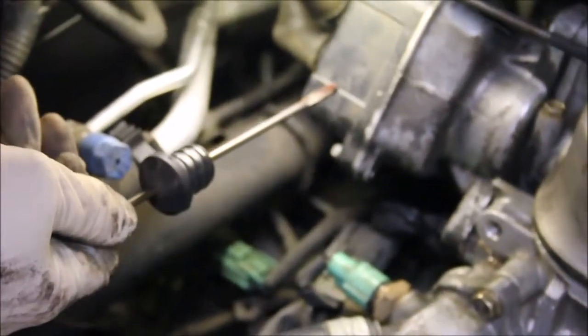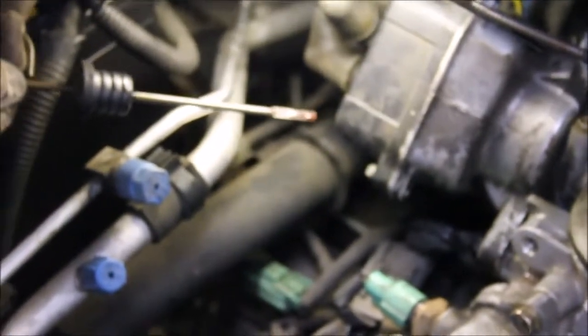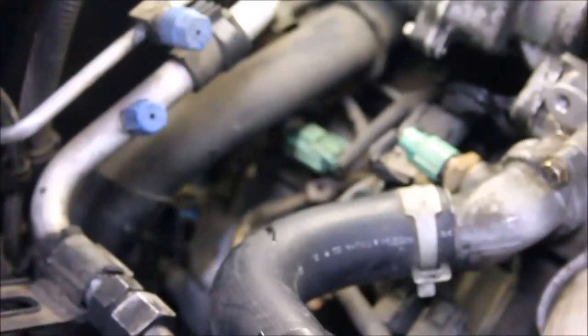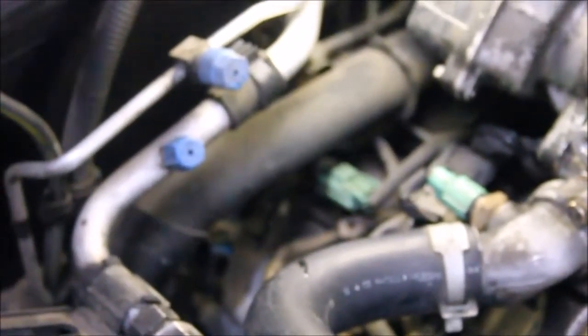Perfect! The level comes right up to the top of the cross marks on the dipstick tube. Even though I'm not changing all the fluid in the transmission — it may hold as many as nine quarts full — three new quarts of fluid will greatly improve the cleansing and detergent action. And with regular maintenance, maybe every 30,000 miles, this should greatly extend the life of the transmission.